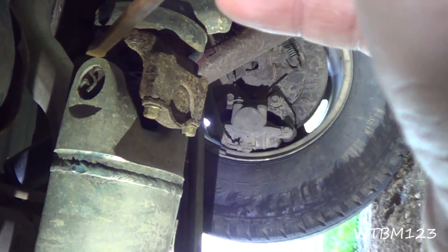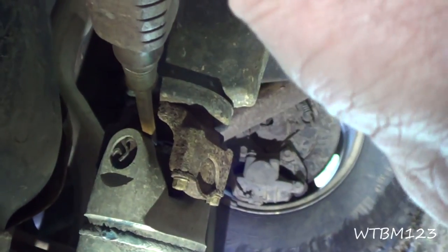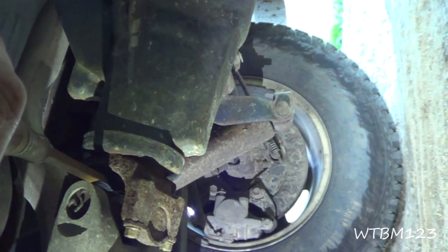You can tap right here a little bit with a hammer and try to get it if it doesn't come out. Or a lot of times I'll put a big pry bar in between the yoke and the driveshaft, and you can jerk it like that, and a lot of times it'll come out. Sometimes they get stuck in there pretty good, but usually with a pretty good sized pry bar you can get right up in between there and jerk them right out.